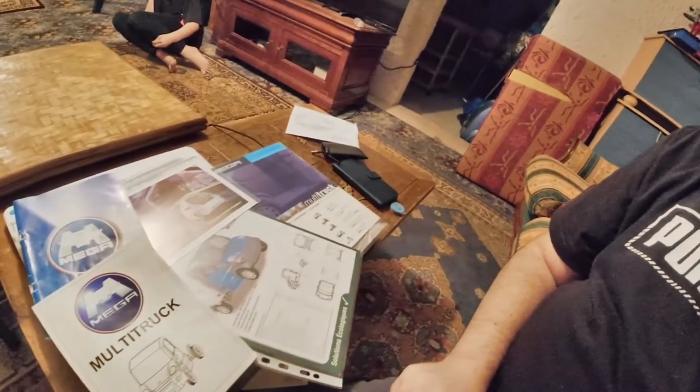So there we go — a few brochures, manuals, and my very small collection for my van. Hopefully I'll learn a lot more from the Phase Two manual, because there's a lot I don't know — especially on the electrical side, since there appear to be some problems. For example, my horn isn't working — no double entendre intended — and there's also a problem with the warning beep for when I leave the headlights on and open the driver's door. It could be a blown fuse, or water could have got onto the horn since it's right on the edge of the chassis near the front wheel. Thanks for watching, take care, and I'll see you again — bye!